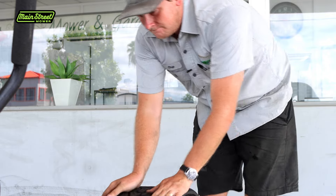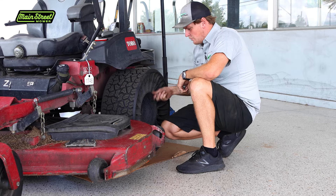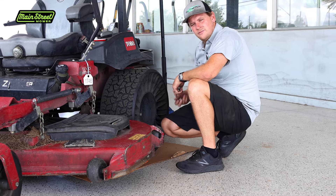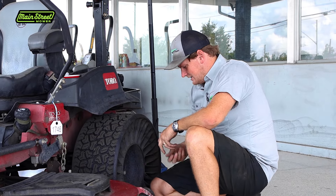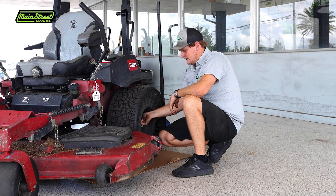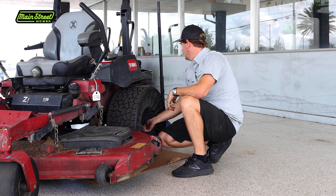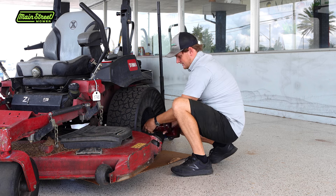With these tweels, it's important that you check and tighten your lug nuts often. Just because they're a more rigid tire, they seem to come loose occasionally. I would just put a wrench on them every couple oil changes just to double check that they're still snug. They're just a little less forgiving than air tires and they can back off, unfortunately. When that happens, it totals the wheel and you've got like a $700 wheel problem. So every once in a while, get your gun out and give them a couple zaps.